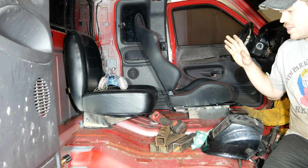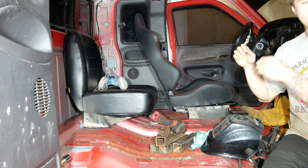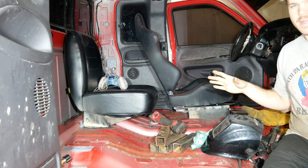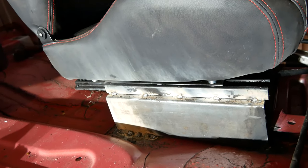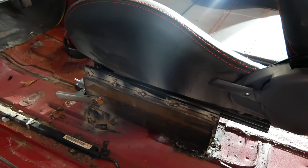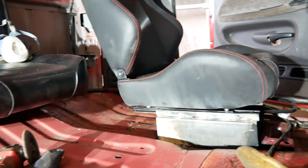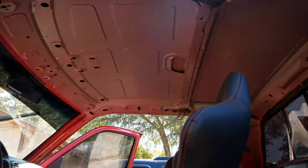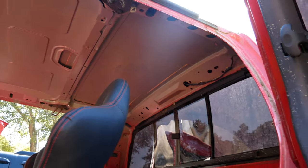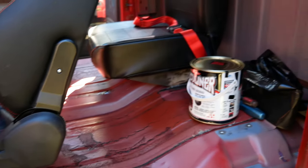Don't mind the mess — this is how the interior turned out. I skipped a few steps; I went ahead and put the driver's seat in. It was getting late, but at least now I can show you how the passenger seat's going to go in and how this is all going to line up. It's really simple. Front seats are a two-by-four also welded to the floor of the truck — these are all very permanent. The sliders are welded to the top of the two-by-four, and the slider mechanism that came with these eBay Amazon special seats is what attaches the seat to the slider. The entire roof is removed, all the headliners, all the electronics — everything's removed. I'm going to leave the soundproofing in the front as well as that rubber soundproofing Dodge put in the factory 20 years ago. No point to get rid of it; I'm just going to cover it with bed liner.